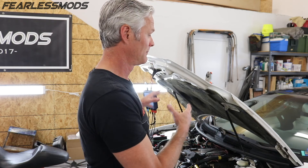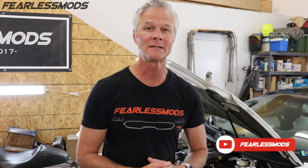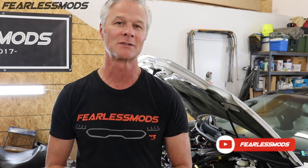But before we do that in the next video, I'm most likely going to do a relative compression check and start back-probing some of those PCM connections to see what some of those other signals are doing, and maybe even dig into the fuel pump and that system just a little bit, just to rule out anything else that could be pointing us towards digging back into that Opti. I hope you're enjoying these in-depth diagnostics for the Pontiac Trans Am — we're learning more every day and getting closer to solving this and getting it running right. Thanks for watching, please remember to like and subscribe, keep watching us for more content, and we'll catch you again real soon. Take care.